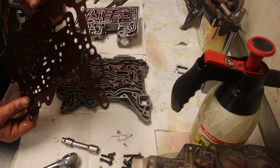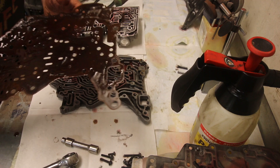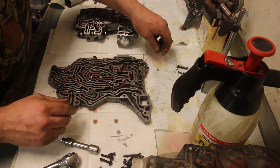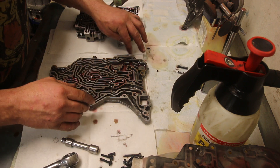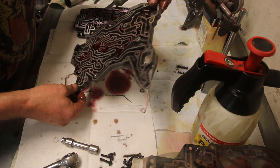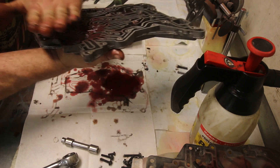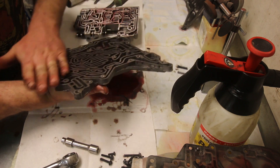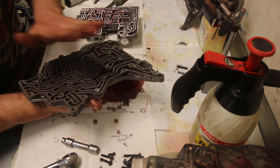This is the gasket for it as well — that can go aside. It's going in the garbage after I decide if it's the exact right system. Very important: some kits come with multiple valve body separator plate gaskets, so it's very important to match them all up and make sure the holes are right. It looks like there's no check balls in the bottom here. One thing you need to know is it has to be dead flat. If it is warped at all, it's not going to work, and you'll have to draw-file it or something. We're going to check it with a sanding block.